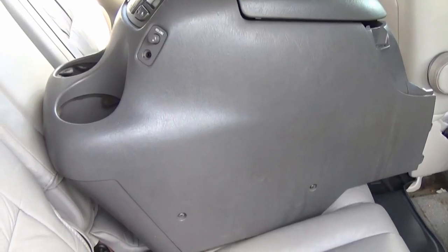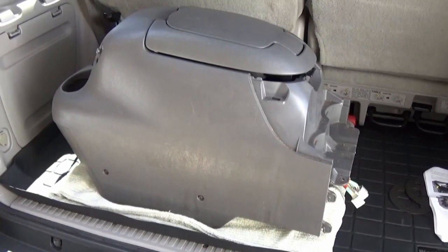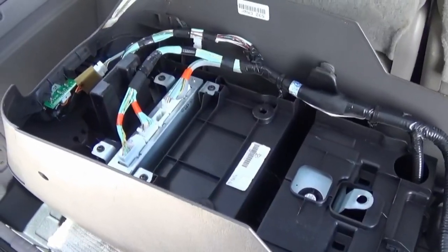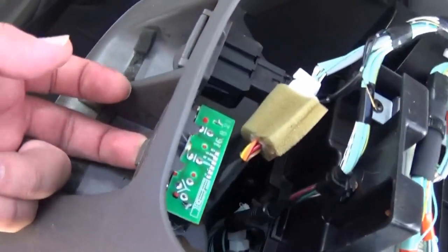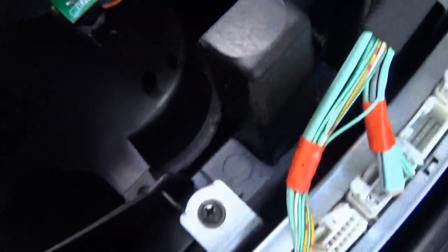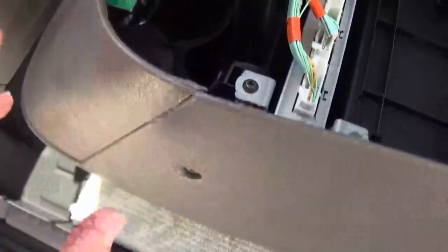Got the console laying on the back seat. We'll take it to the back, flip the console over on its lid, which gives us good access to the bottom. Underneath the center console, you can see the RCAs and the power outlet. There is one screw on this side and another screw on that side. It also looks like there's a screw right there and another one on that side — those are holding the cup holders in. Let's get these screws removed.